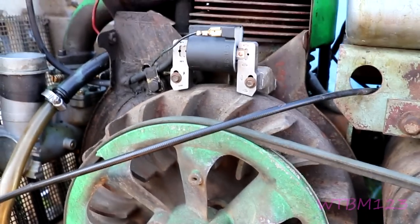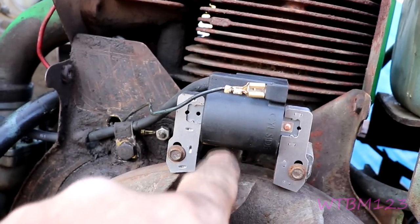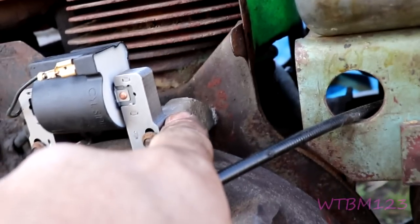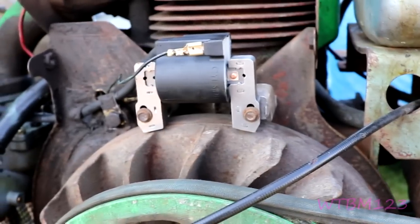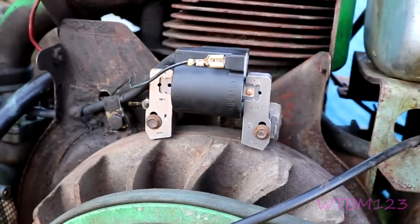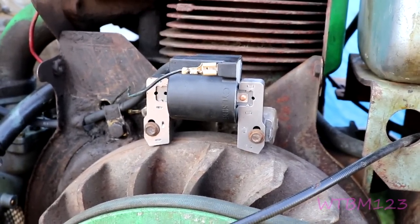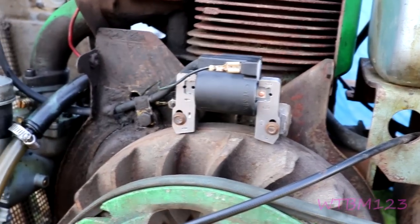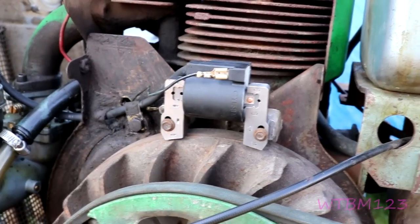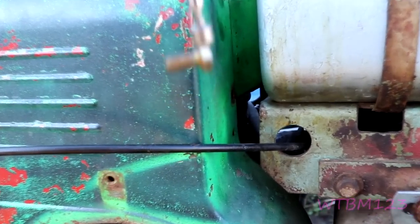One more thing — some of these newer magnetron coils have a dot for the sensor eye. This one doesn't seem to have anything. This bracket in back is adjustable for timing but I don't move it — it seems to do fine. I think for the nova system or the points trigger you may have to move the timing, but for these I just bolt them on where they were and they work. I never really went through the whole procedure to check timing — I just bolt them on and they work fine.